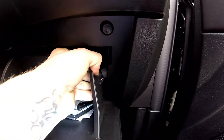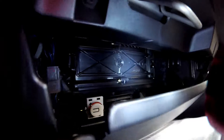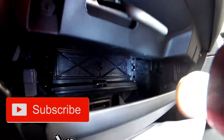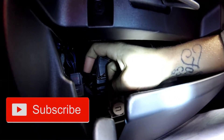Your cabin air filter is under your glove box at your passenger knees. Gently push the tabs inward into the glove box — I just let the glove box dangle right there. You could take it off completely if you wanted more room, but this is just quick. Right there is the cover to the cabin air filter. There's a tab on the right side, a tab on the left, and the door comes right off.